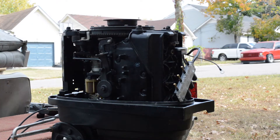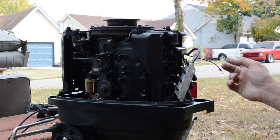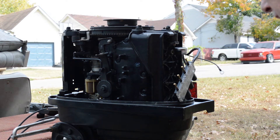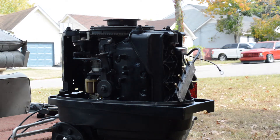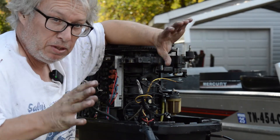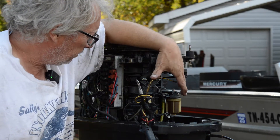Alright, I got my compression tester on the top cylinder and my little spark checker. I'll put the key on the ignition in the run position and do a compression test. I can mark each cylinder with a little white pen. This has progressed to where I had to remove the carbs. So I got spark, although the bottom spark plug seems a little weak — I might recommend replacing spark plug wires. But I've got compression.